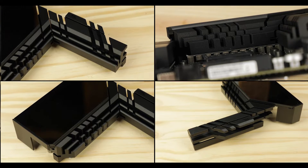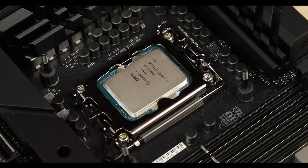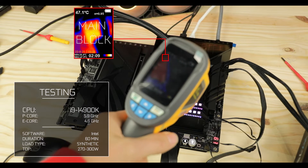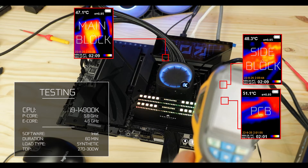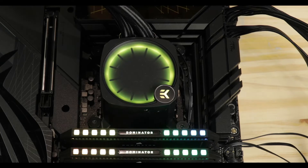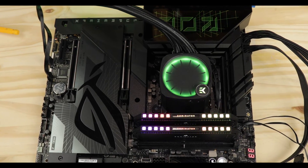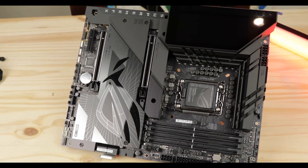In short, this is a really beautifully designed piece of cooling hardware, and results are unsurprisingly good. With my i9-14900K clocked at 5.9 GHz, after an hour-long synthetic stress test, both blocks fared brilliantly and stayed around 50°C for the last half hour of testing. The only problem is the i9 processor itself — no matter how good your all-in-one cooler is, it will struggle to keep things cool even at stock clock. A 250 to 300W power draw is massive.